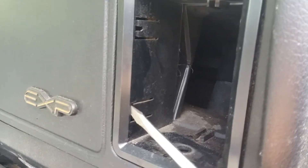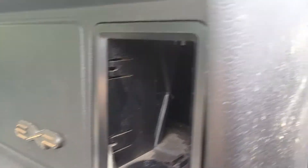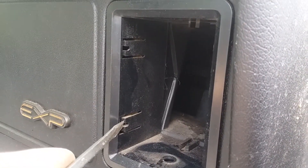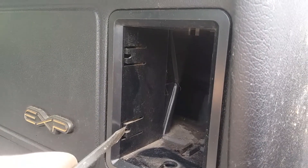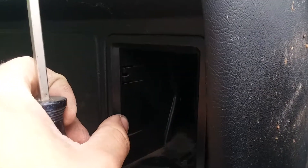Removing the bezel that they go into is also pretty easy. You grab a flathead screwdriver — you can do this two ways. You can go at it from this angle, and if your screwdriver is the right size, it'll peel up like that. Once you do that, you'll want to stick a screwdriver in there to hold that tab open while you get the other side, because you'll need two hands to do each one of those tabs. You have to do two on one side before you can tilt it out, and then do the two on the other side.